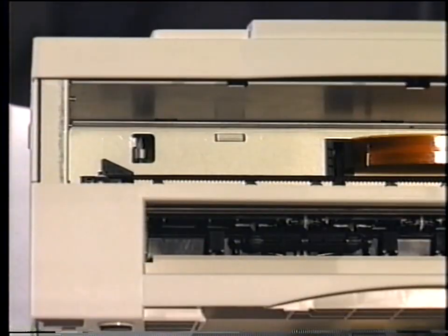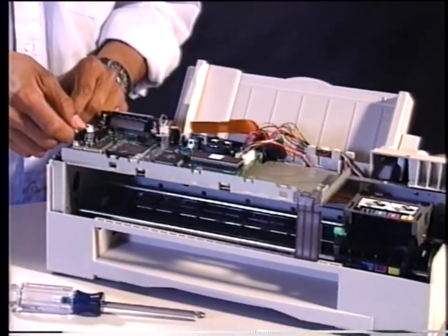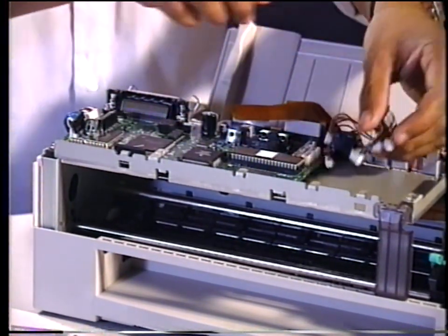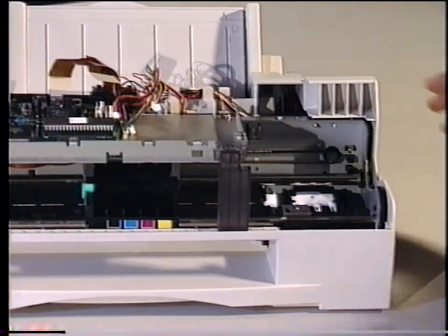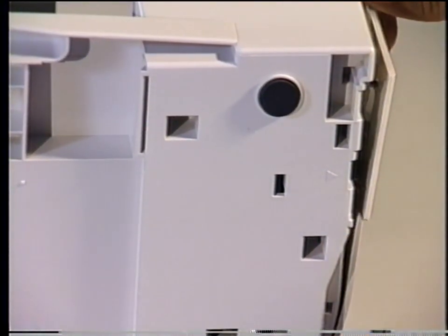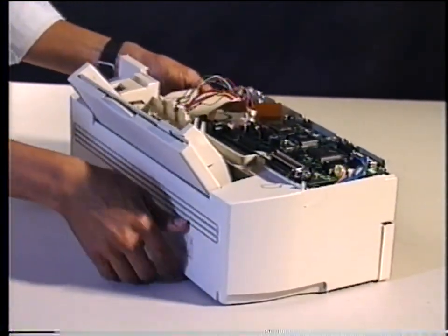To remove the inner cover, flex the two latches on the inside front of the printer and then the two latches located on the inside frame. Remove the panel board by removing these two screws and disconnecting the ribbon cable. Disconnect the wire connectors and ribbon cables from the control board. Then unhook the wires held by the main cover. Slide the carriage unit to the center of the printer. Locate the latches on the bottom of the main cover. Detach the latch on the right with a small screwdriver while lifting out the side of the main cover body. Now do the same on the left. Turn the printer around. Unhook the two latches from the bottom of the printer to lift the cover up and off.